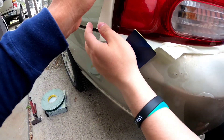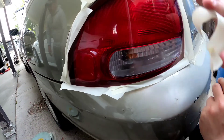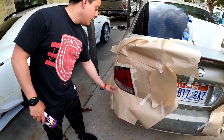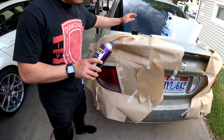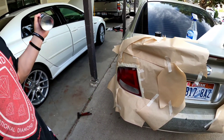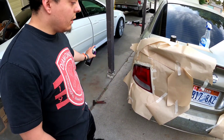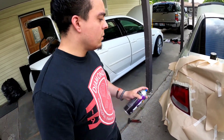We're gonna rip the tape into pieces so they have a little more give, then put paper inside those areas and cover it up, then we'll paint it. We've got it all covered — I know it's a bit messy but it really doesn't matter as long as everything's covered, because this spray can go pretty wide. Shake the can for eight to ten seconds. Unlike a normal spray can, you gotta move the whole thing back and forth in an even manner, about six inches away from the light.